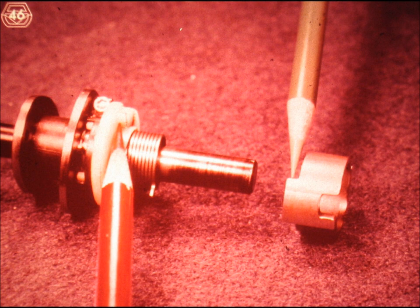In reality, it takes more than this step in order to stop the cycle shaft. When the cycle clutch sleeve is stopped by the cycle clutch latch, the latch obviously also stops the step in the sleeve indicated by the green pencil. The continued rotation of the cycle shaft will eventually cause the step indicated by the red pencil to stop against the step indicated by the green pencil. So, the cycle clutch latch has to stop first the cycle clutch sleeve and then, indirectly, the whole cycle shaft.